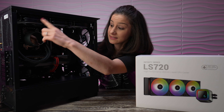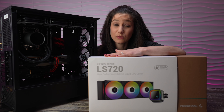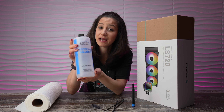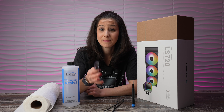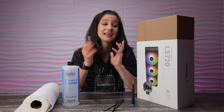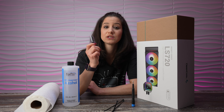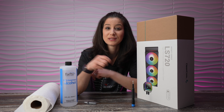Now here's our AMD build that we did together. This is the top-mounted AIO that's coming out, and we are going to replace it with this. But before we do that, there are some supplies that we need to gather. The first one being a number two Phillips head screwdriver. You're also going to need some isopropyl alcohol because we're going to use this to clean off our CPU, and some paper towels. I also recommend having some thermal paste, even though the cold plate on this AIO already has pre-applied paste. In case you touch it, disrupt it, or you just want to apply your own, you're going to need to clean that cold plate off with isopropyl alcohol and then add this to your CPU, which I'll show you in a little bit. I also recommend some zip ties so you can clean up your cables once we get this in place.